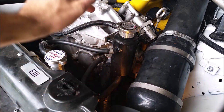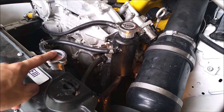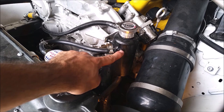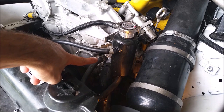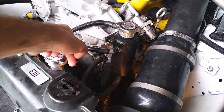I don't have the bleeder screw on the back of the motor anymore because I don't have any heater hoses, but you can set yours up just like this. Just put a blanking cap on top of your radiator, run a hose from there into the side of the swirl pot — it spins all the way down, exits out this hose, comes around, and goes right into the thermostat. Then you have this last pipe that runs all the way to the overflow.